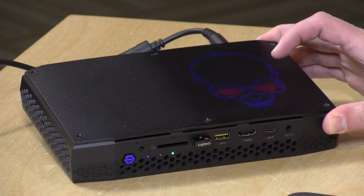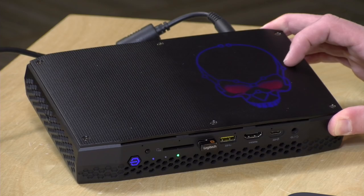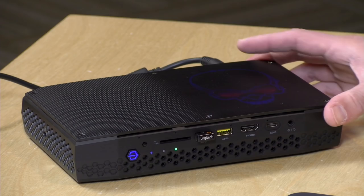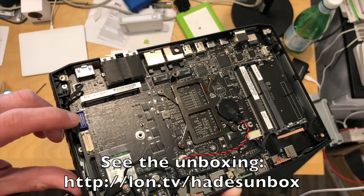This is the entry level device running slightly slower than the higher end version that costs about $200 more in kit form. This one at $799 has an i7-8705G quad-core processor — Kaby Lake G — paired with a Radeon RX Vega M GL GPU on the same package with 4GB of video RAM. Since this is a kit with no RAM, storage, or OS included, I added two sticks of 4GB DDR4 to get 8GB of RAM.